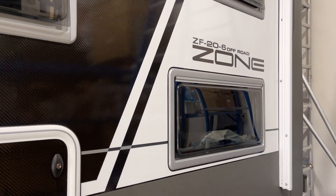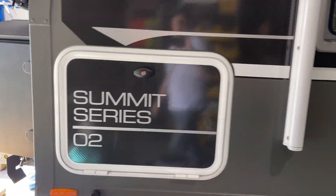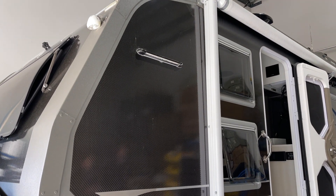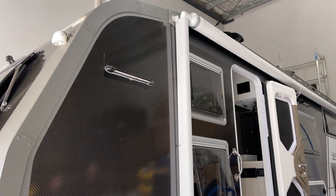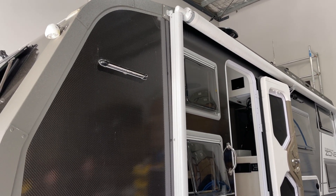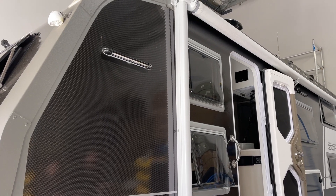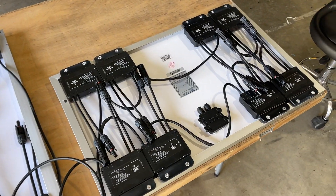Hi, Bruce from Safari — you'll recognize that brand and you'll know that this is their top-of-the-line caravan. But it didn't have enough solar on the top, and this owner wants maximum solar. So we're getting 1500 watts on the top. To achieve that, everything is pieced together with mixed panels — we've got four different types of panels — and now we come down to the secret of how we put those together.